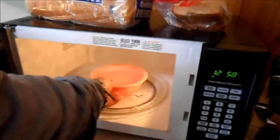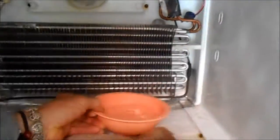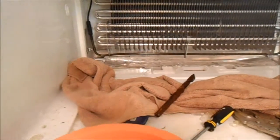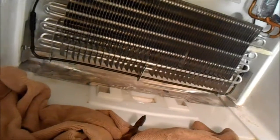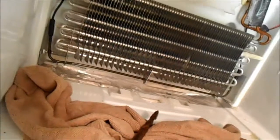Get yourself some hot soapy water with a little vinegar. Maybe that drain will melt clear. You have to be very careful with these tips here — they contain the refrigerant gas. This is pressurized, so if you accidentally poke that you'll be in big problems.